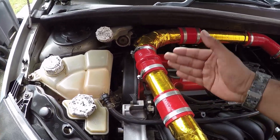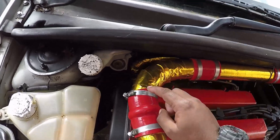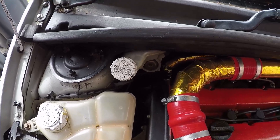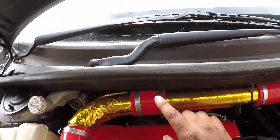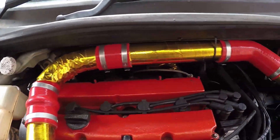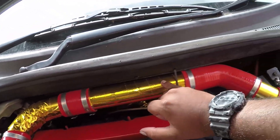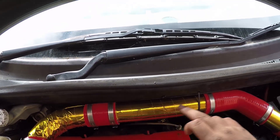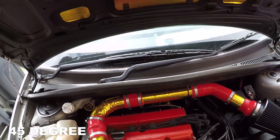Starting at the throttle body, it's a 60mm to a coupler that goes onto this diameter bend, and then this was a 300mm hose which I cut down to fit in between here just to keep it off the rocker cover and push it out of the way a little bit. Then from a 90-degree bend with a coupler just bending it slightly that way — it's quite flexible. This one here is cut in half from that one there so I don't have to buy two. That's another 300mm hose that goes straight from the back of the firewall over the top of the headers.